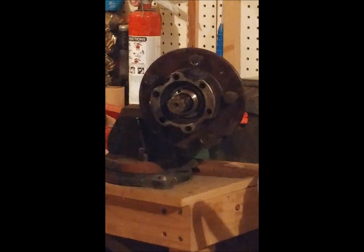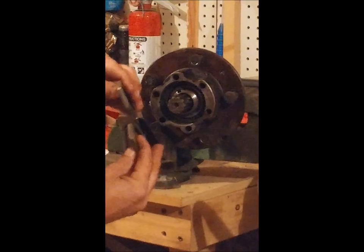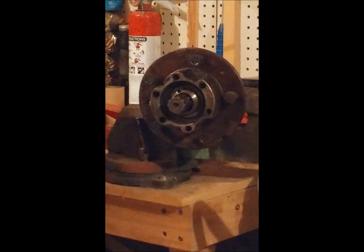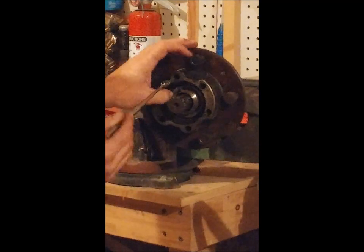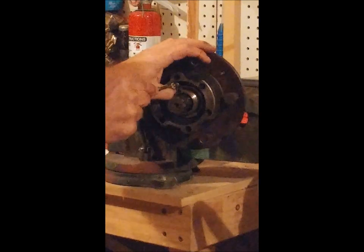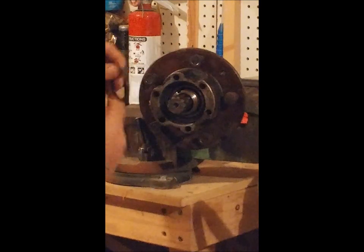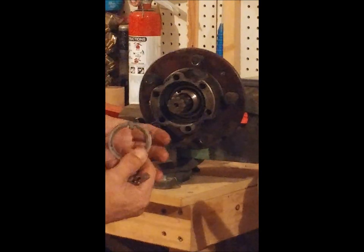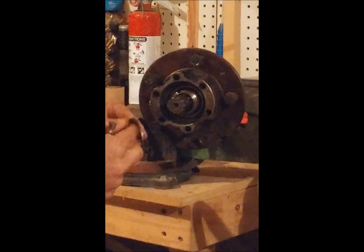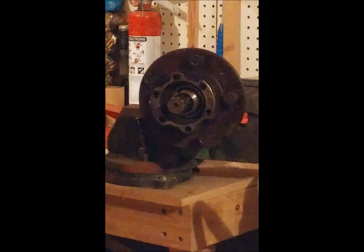Like I said before, the second nut is pretty much identical to the first one, so if you get them backwards, it's no big deal. The second retaining washer also has a detent in it, except this one just has that — there's no popped-up detent for it. That's the only thing that separates the front from the back, other than the dimensions of the sides.